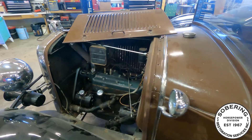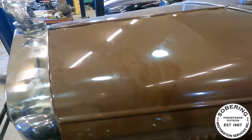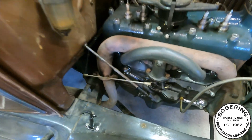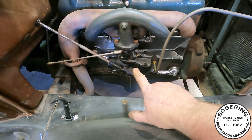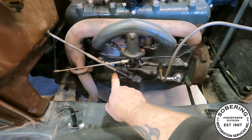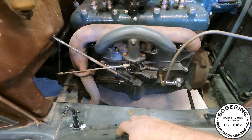I still got to figure out the proper way to start this thing. The carburetor — I believe I got the float set too high. It's an updraft carburetor, and for some reason when I pull out the choke before it fires up, there's a giant gush of gas, hits the floor, and then it starts. Obviously not supposed to work that way.